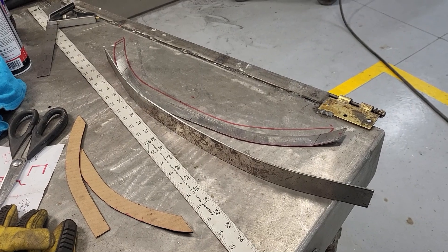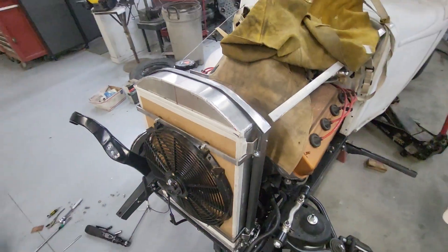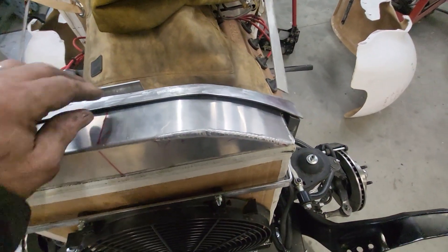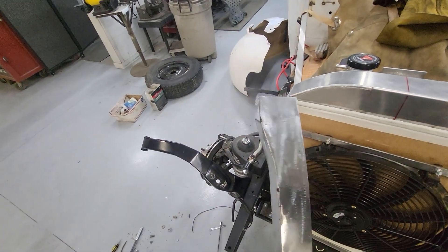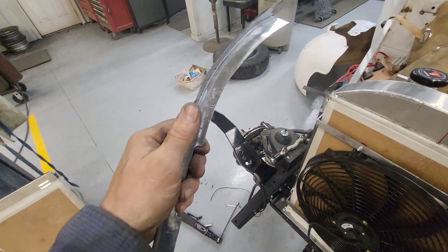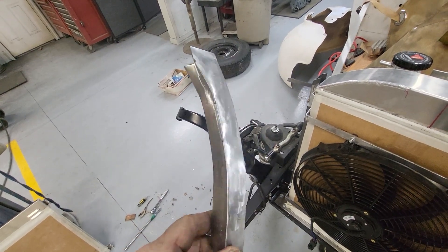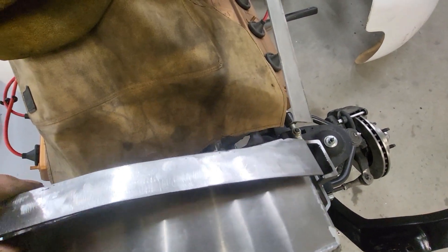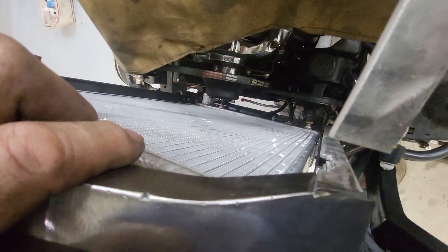It's the next day. I cut my two pieces out — that top piece I showed you in the last video, and then I cut out an inch-and-a-half ribbon and tack-welded it on the back to follow the profile of the first piece. I welded it up and ground it basically. The plan is to put it onto the radiator and then marry that piece there — and that piece there — like so.